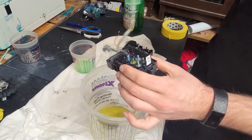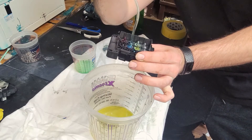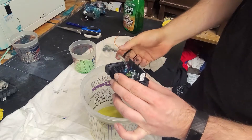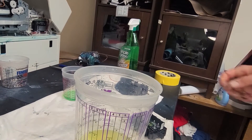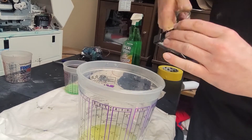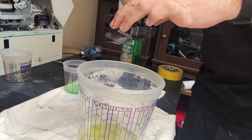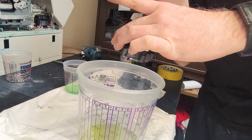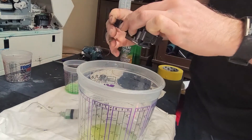So you'd want to take it, move it over to the next one, so on and so forth. The colors usually flush out pretty easy. I'm going to reposition the camera angle so we can see it better. Let me suck up a little more liquid here — hopefully we get a good shot of what it looks like as it's shooting out the bottom. And this is what we're looking for here: a nice waterfall out the bottom of the printhead like so. This is what formulates your design when you print — it comes out the bottom.